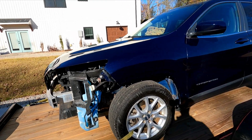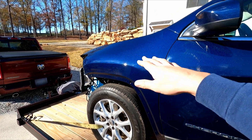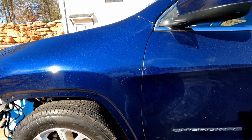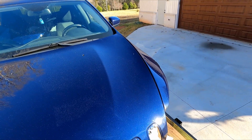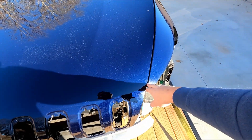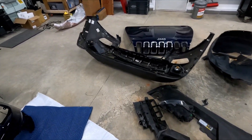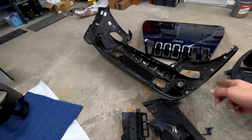I'm just back from the paint shop. My friend Brent over at High Performance did the paintwork on it and it came out really nice — the blend is really good, can't really tell. He blended the top of the fender and then cleared the whole fender. Once I get it put back together and detailed, the doors, A-pillar, and roof are really dull so we'll buff all that out and it'll look pretty nice. The paint matches spot-on. I just need to do a little bit of work with the gap over here — this side is nice and flush and even, but the other side is a little low through the middle. The next step is to go ahead and reassemble the front bumper, pulling all the clips from the old bumper and transferring everything — including the fog lights — to the new one.